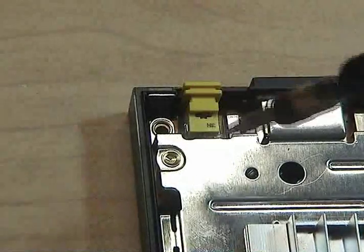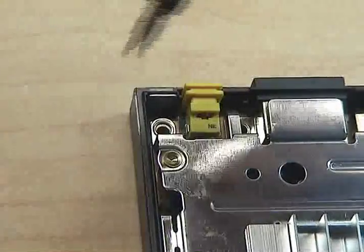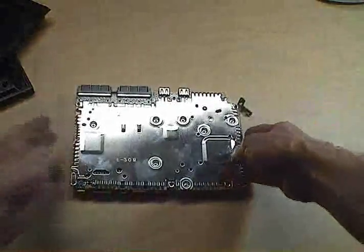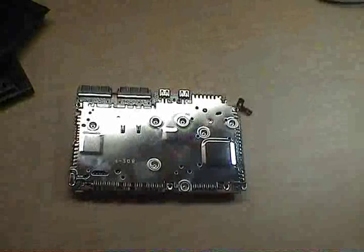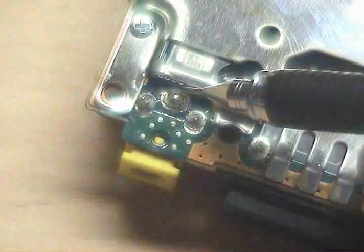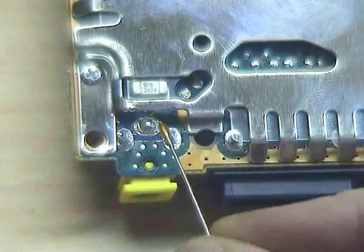Next to the yellow power jack, there's a grounding loop on this piece of shielding. The primary clip that will hang you up is right here. You don't want to pull on these because you can pull them off the board, especially the AV connectors. The correct place to pry is right there. When lifting the far side of the board up, pry up slightly right here and the whole thing should come free. I'll flip this over so we can look at the back. Our power connector is down in the lower left corner. And here we can see the crux of our problem — even from this distance it's clear that the third solder connection, the one in the center, has a crack running through it and has been pulled away from the board. The next step is to get out your soldering iron, your flux and solder, and freshen up these three solder joints to complete the connection.